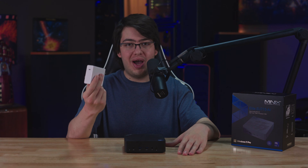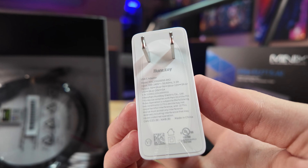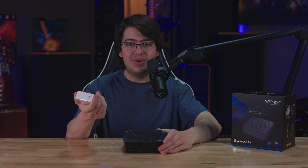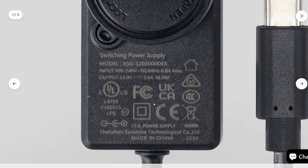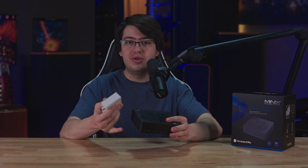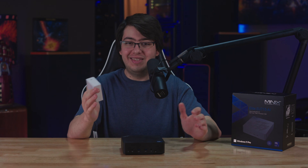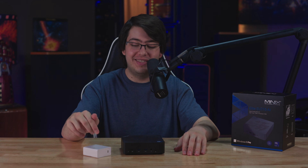Something I really want to emphasize is that USB-C power adapter. On the surface it just looks like any old USB-C phone charger, but reading the label, this is actually a 100-watt USB-C Power Delivery charger — which means it won't fry your other devices if you plug something else into it. Most other mini PCs we've tested that use USB-C have shipped with power adapters that are not USB-C Power Delivery compliant, meaning they output 20 volts no matter what you plug in, with no communication about what voltage should be sent. That means if you plug a bad charger into your phone, it might explode. So seeing that Minix included a safe, compliant power adapter is something I really appreciate, even if it shouldn't be remarkable in this market.